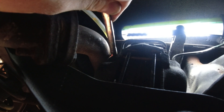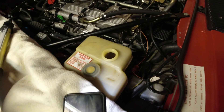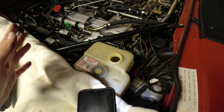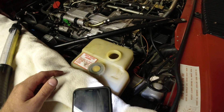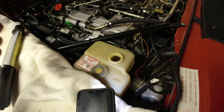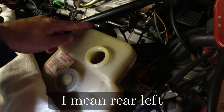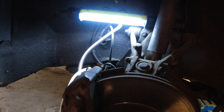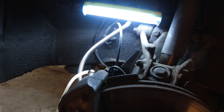We're going to close up the bleeder. We've done the rears, and there wasn't that much air in the system. Usually after a while, you hear the pump run a bit — maybe after five or six seconds the pump will start running — and that usually pushes out the last air. I only have some bubbles on the right rear. Checking — still have a lot of fluid left in the reservoir. So now we can move over to the front, which are a lot easier. The reason I'm doing the fronts as well is because I replaced the brake hoses here also.